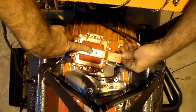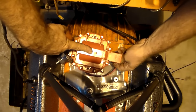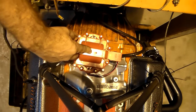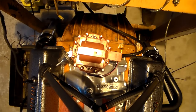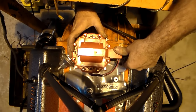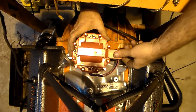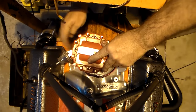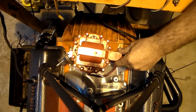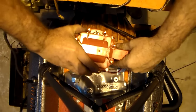Battery positive lead from the ignition or your key on these distributors — the other lead comes up from the bottom. This is one of the easiest distributors to install. This will put your part of the distributor where you hook up your leads right to the side here, so it won't be too close to the firewall. Your vacuum advance won't be up against the firewall either — you'll have plenty of adjustment for advancement and retardment. Pretty much they come out even like that and you're pointing at number one, ready to fire, good to go.